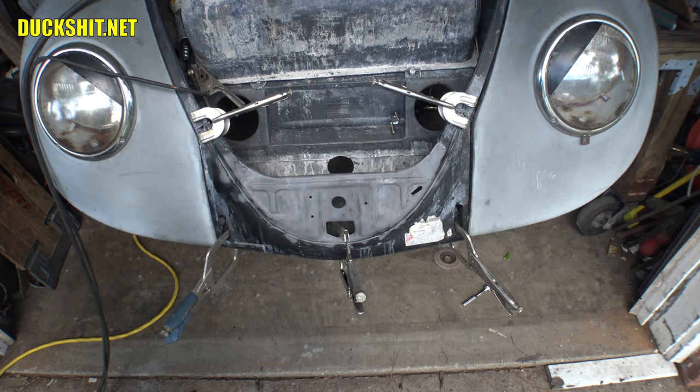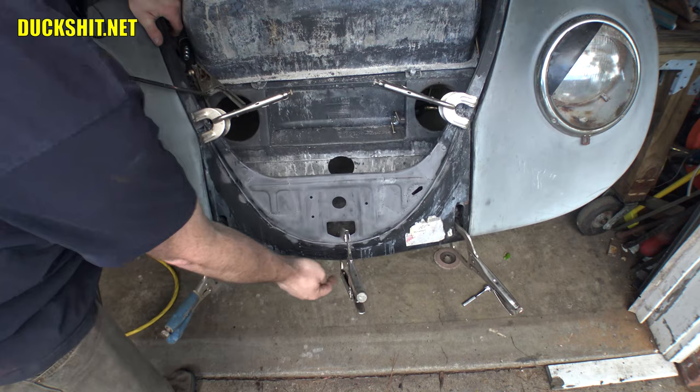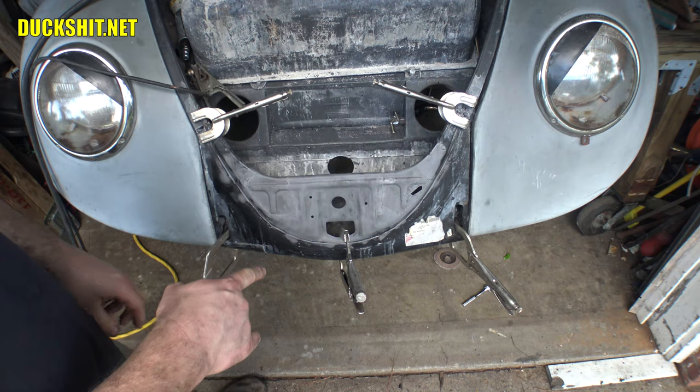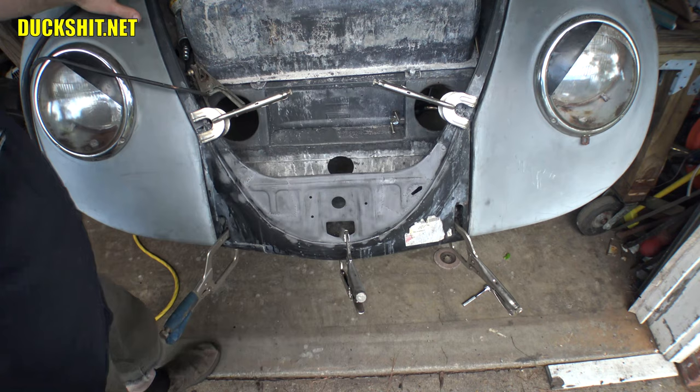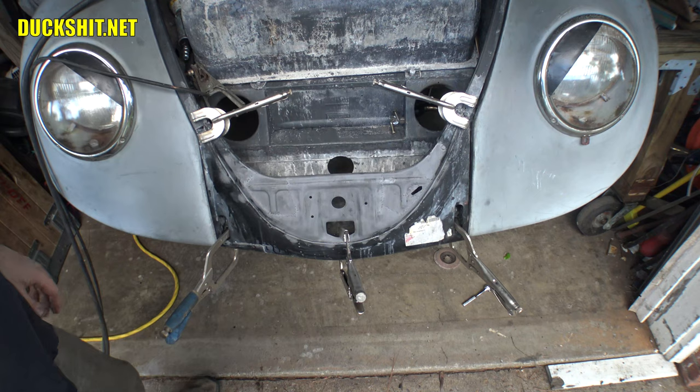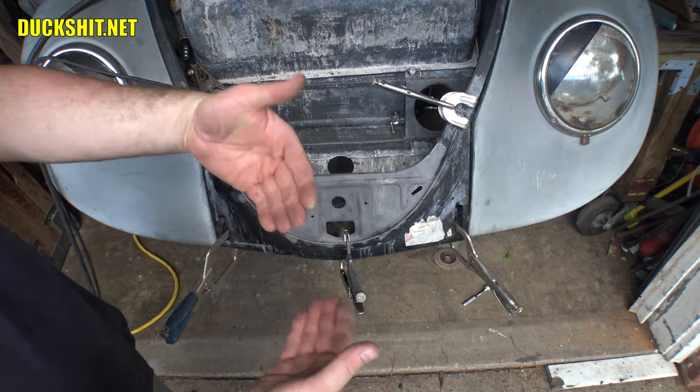Inside here, we've got the clamp, which is holding the floor, which is normally square and flat, to the bottom of this V shape. So it's pinching it and pushing it down. In doing that, the floor got stretched because it was used to being flat, so it's gotten pulled. And as a result, it shortened. And the tolerance on that is pretty damn close. That's pretty close. Wow. If I made that floor about another half an inch shorter, they would have missed. So I think we're good. I think we're really good.